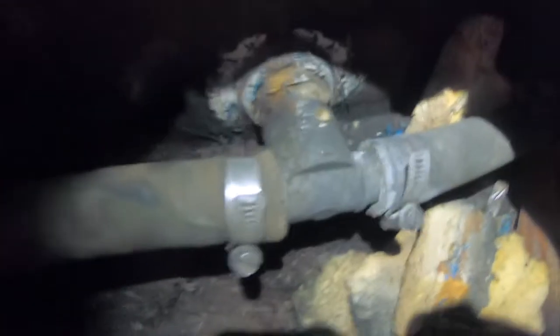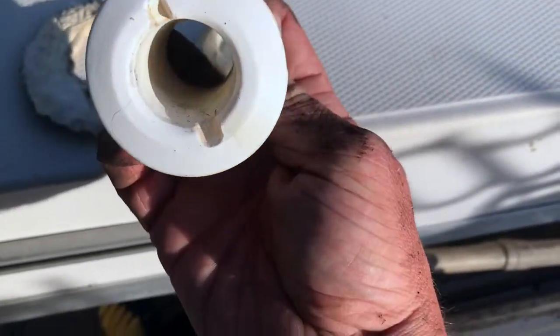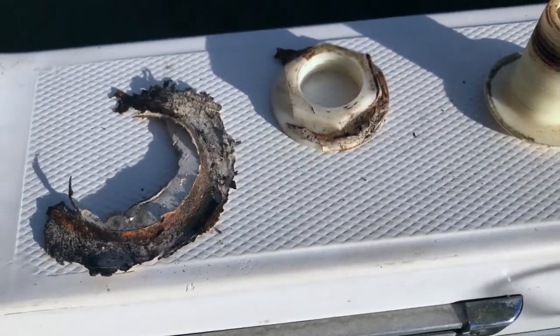Now I know this is everybody's favorite part about owning a boat — boat maintenance. What I'm going to show you real quick is where my fitting comes in. It goes into a T, but I'm just going to worry about getting that nut off. I'm going to take my channel locks, hook up to it and give it a twist. Now that I've got a little bit of light I can show you a little better. This is the old fitting — like I said it wasn't bad yet, but that crack had me nervous enough. As you can see, it's actually a crack there. So we got rid of that. Here's all the adhesive it pushed out on the inside; we're scraping the outside now.